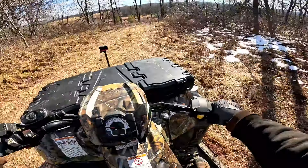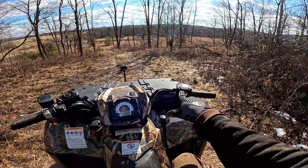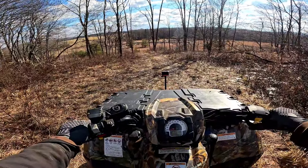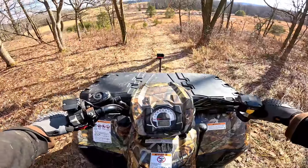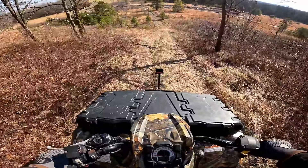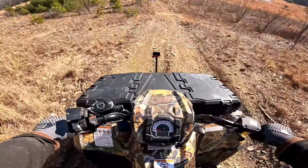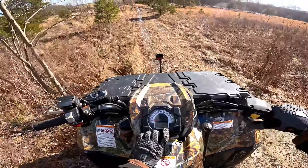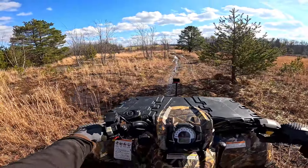So this is four-wheel drive. In case you don't know, here is what this other switch is for — it is actually an active descent control that uses all four-wheel drive, locks in the engine braking, and makes it awesome for going downhill. We're in high gear four-wheel drive and the engine braking is still very good on this — we're just creeping. Let me lock into active descent control — you can hear how it's stuttering. Look at this, it holds you back even more. The nice thing is as soon as you hit the gas, it turns off. A pretty neat feature — I don't think Polaris offers that anymore, but it is a very neat feature.